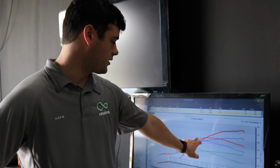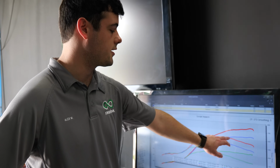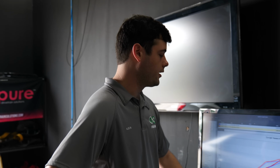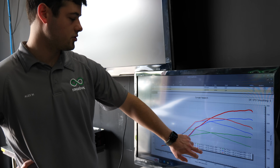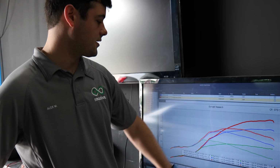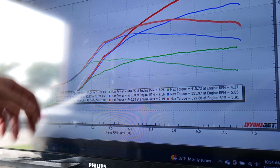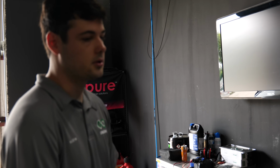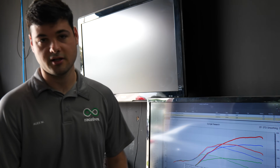Whereas with the higher boost one, torque starts to fall off because we're increasing boost across the way. That's how we keep the torque flat between the two, running the same timing. And obviously the other great thing about these turbos is the variability in boost control. At a flat 14 psi, we're able to make 418 wheel horsepower and 415 wheel torque as a daily map. That is very nice. Super conservative, a safe, manageable daily map if you wanted to limit the power, or have anyone else drive the car, stuff like that.